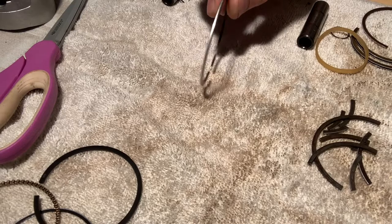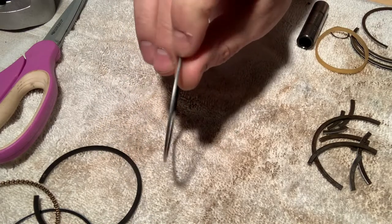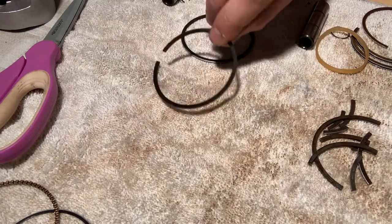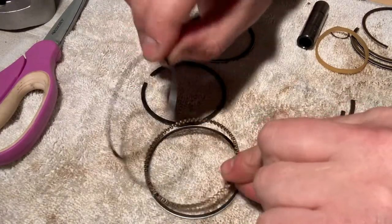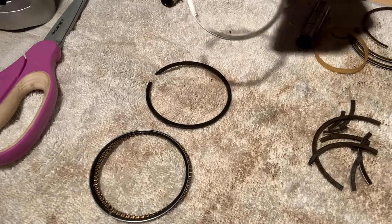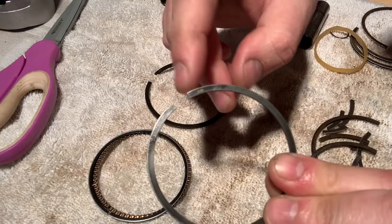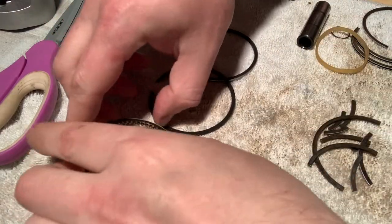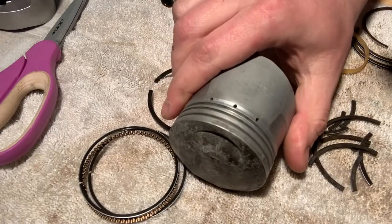We have a kind of a chrome or stainless ring. Looking at the side, you can tell we've got a stainless - it's probably stainless - top compression ring. Then we have just kind of a steel, it's a dark color, just black. That's your second ring. And then we've got our oiler rings. As suspected, this one actually gets sandwiched in between these two. So these go on the bottom, here's our middle, and here's our top. Each one of these is going to have a little marking or word right next to the edge - that's going to be up on the piston.